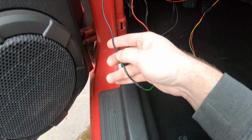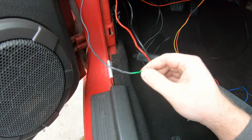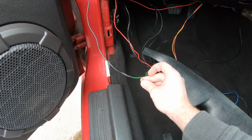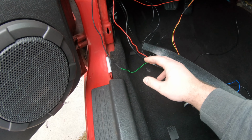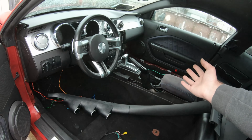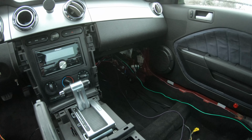The only wire I had at the time was this heavier gauge, like 16 or 14 gauge, where this stuff is like 20 or 22. So I'm going to run the same length wire, solder everything, no butt connectors. They'll sit nicely in here. I'll have all new wires, I'll know what everything is, and it'll be much simpler put together. It'll be easier to fix any future problems.